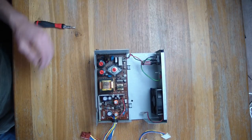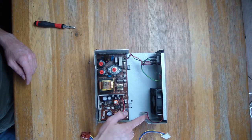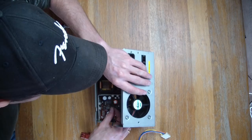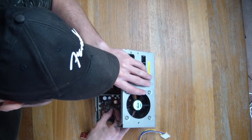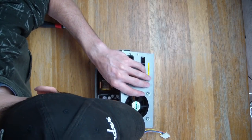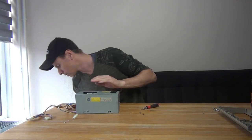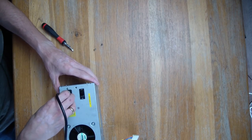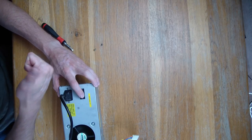So it's pretty bleeding obvious what is wrong here. The fan is right here and as you can see, this little plug is disconnected from the mainboard. So I think if we put this here — plus on that side — it should probably work again. We can test it right now actually. That works.